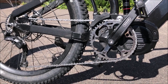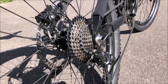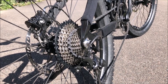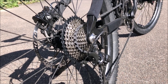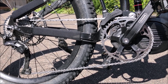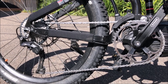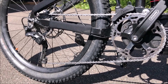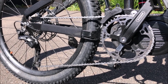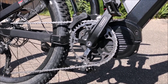I've done that by putting on a 46-tooth steel chainring from Surly at the front — that's really hardened steel. At the back I've put on an 11-to-40 cassette and I'm running a KMC X11e chain. I did also try a number of alloy chainrings but unfortunately they were getting chewed up very quickly by the sheer torque of the motor, which I think also exacerbated the chain wear.